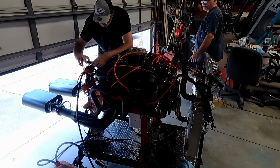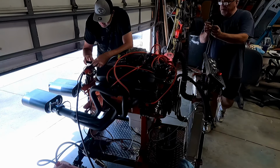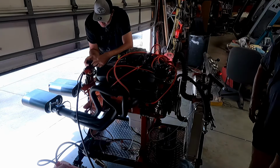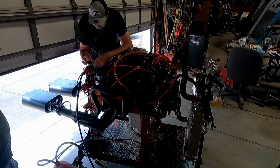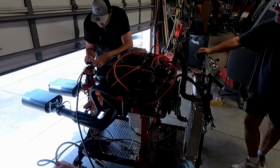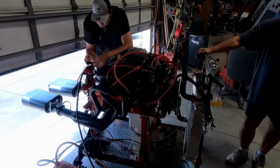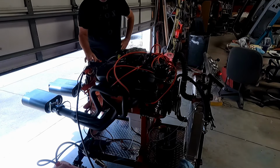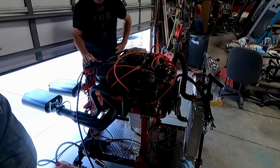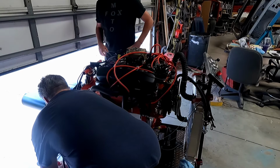Yeah, the Sniper 2 has a big screen. 5-inch. It's still small, but they have an app. You can get an app to do it on your phone. Oh, really? Attachment for this. What's our idle speed? 850 something? Yeah, probably. Golly, 1960 is where it jumped. 870 is what it is. That's fine. And I don't know what the wide open timing is. I think it's 50 something. Put it at 40 or 45 first. I want to pull that forward. When I hit that button, I don't want it to be going down. So I want to raise this up. Oh, right. Then I'll block it. Okay. Go ahead.